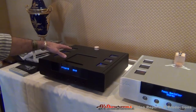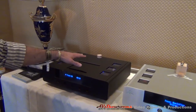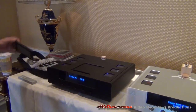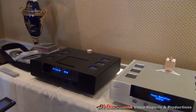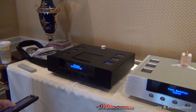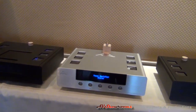The one-box CD player has its own digital out — it's got a digital in, it's got an SPDIF in as well as an SPDIF out, and it has a USB in. So it can be a CD player, it can be a transport, and it can be a DAC. So it's got, as everything AMR does, very flexible and unique capabilities.